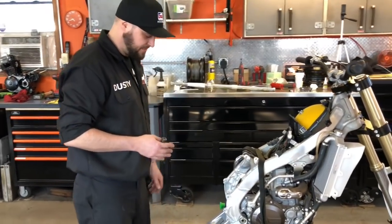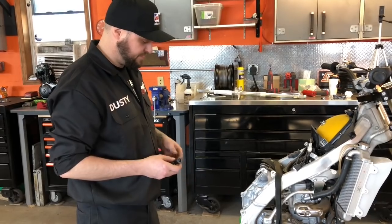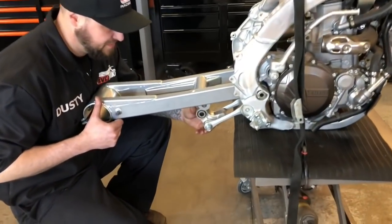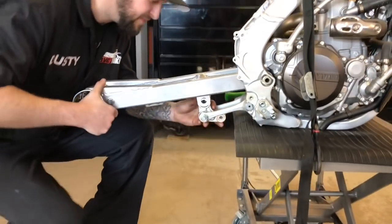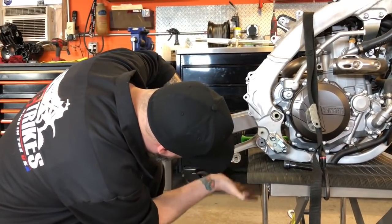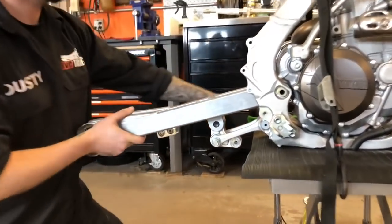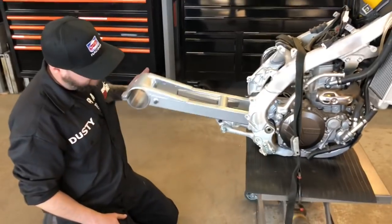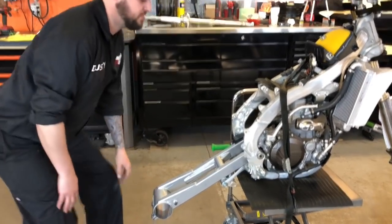Since you're changing up your swing arm, the bolts and everything varies. We also include a grade 8 hardened bolt that is machine fit, made for our setup, included with the kit. Go ahead and slide that one in. I always keep a little hammer on this in case you've got to give it a shot — get that set through. Swing arm's on, your linkage is in, all your bearings are done. Pretty simple. The next step would be to install your shock.